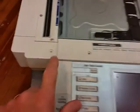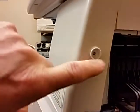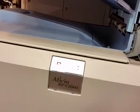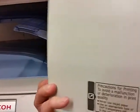To start, you're going to pull off the top panel screws, which is here, here, and here. Then we're going to come down here and open up the side and pull out that side screw right there. Because I only have one hand, I've already kind of pre-pulled it, but you have to reach in and pry the sides of it out because of a little notch right there that will be over on the left hand side.